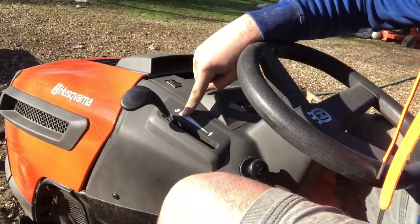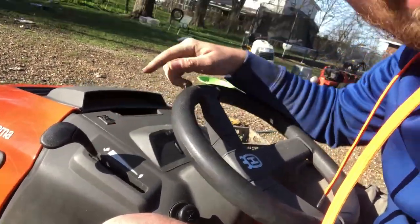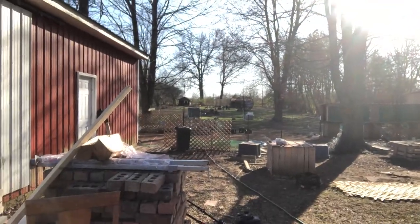Sorry about that. So I figured out the problem. The power, all that, was down here instead of up there like it should be. So we take the wagon over there, hook it to this little tractor, since we had the mower deck off, and we use it to haul water way to the back where the alpacas and the chickens are. But I'm guessing since Celia did the animals, like she usually does in the morning, she must have turned it way down. Anyhow, when I started it and the deck engaged, since the power was all the way down, it stalled it out. So thankfully it was something simple because I was about to have a conniption fit.